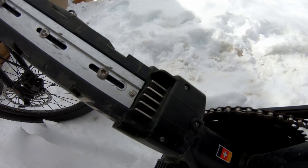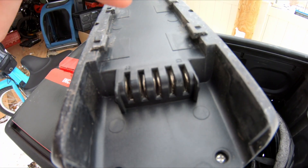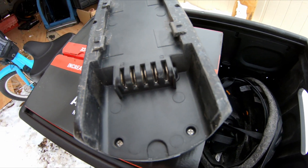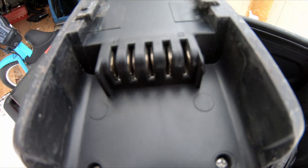Once you know that all connections are good, go back to the battery. Just because it turns on doesn't mean it's making a good connection to your cradle. Check your cradle — are all the pins working and looking good? Do they look burnt? Sometimes these pins, every time you take the battery on and off, it can create a spark. If you do enough sparks you'll ruin your connection. You'll have to file it down or put a new connector on there. Every battery may look different but it's the same idea.